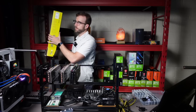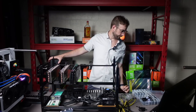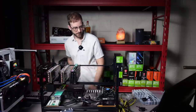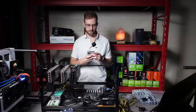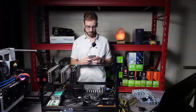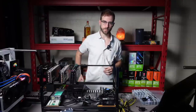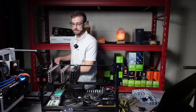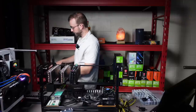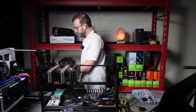Altogether, that gives me 1760 watts that I can use out of the system. Let's do the math — 290 times 6, and just GPUs ran full tilt, is 1740 watts. So that's good. The motherboard and stuff will take anywhere from 50 to 100 watts. So we're really close enough, but we'll be all right.